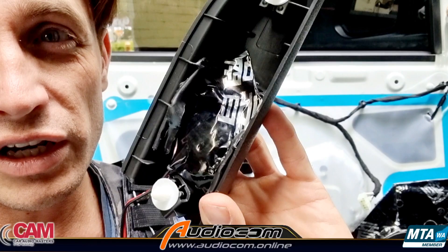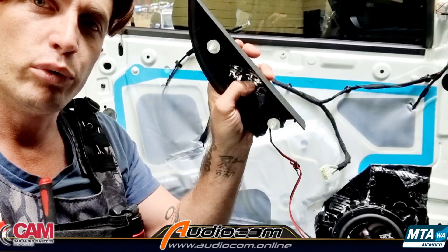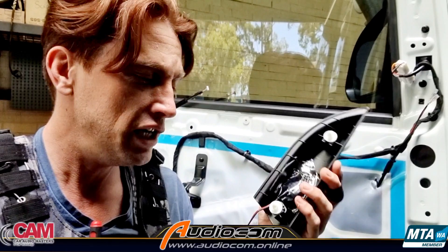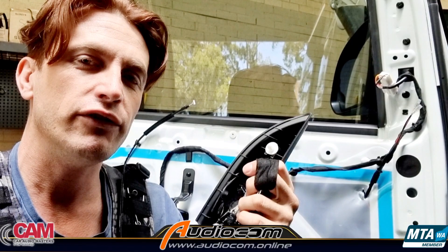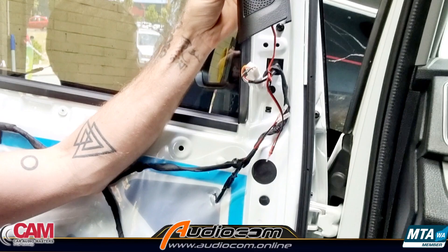You can use a piece of scrap sound deadening material and layer it thoroughly around the tweeter to secure it — it's a good semi-adhesive mount. I've done this hundreds of times and never had it fail, as long as you push the material in firmly and clean the surface beforehand. That thing will stay put forever. We'd only make a heavy-duty metal bracket for a bigger, heavier tweeter — for this application, this method is quite fine.